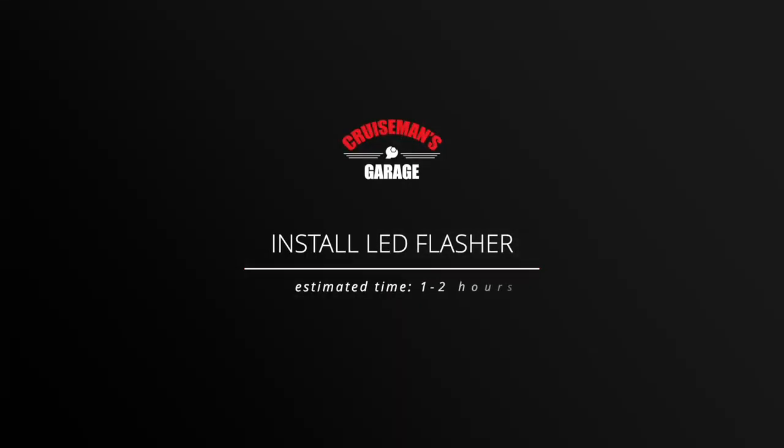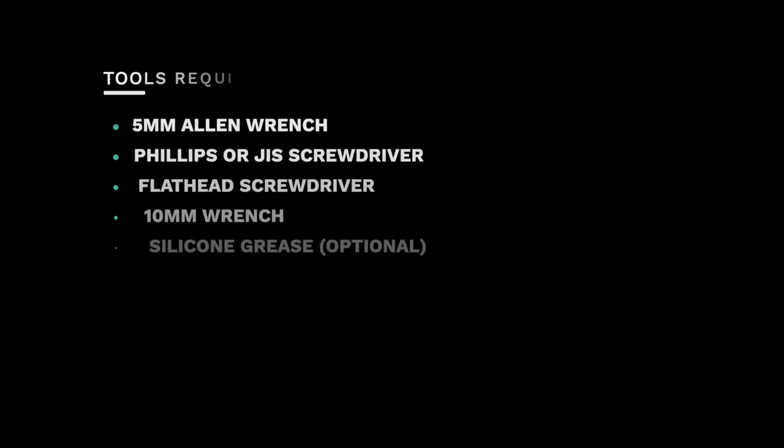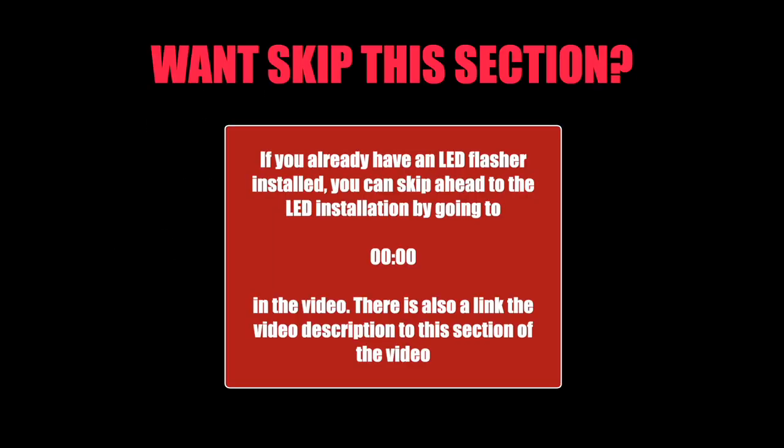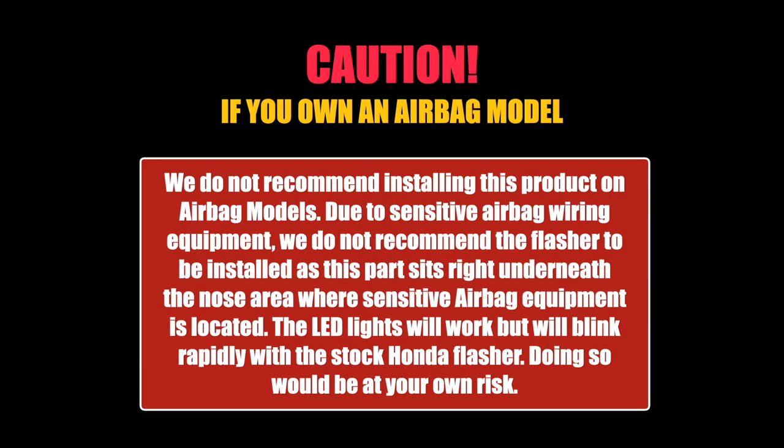For your LEDs to flash properly, you need to install an LED flasher if you haven't done so already. Here are the tools required for this job. If you already have an LED flasher installed, you can skip this section of the video by going to the time code below. Now, if you own an airbag model Goldwing, we don't recommend installing this product. You should have a qualified Honda service tech install the LED flasher for you.